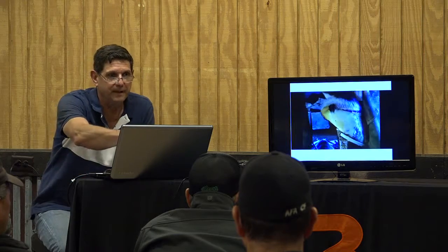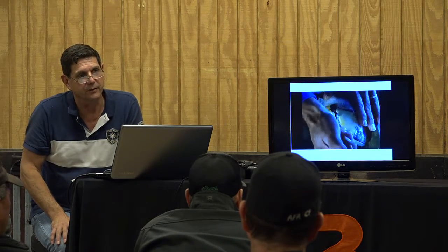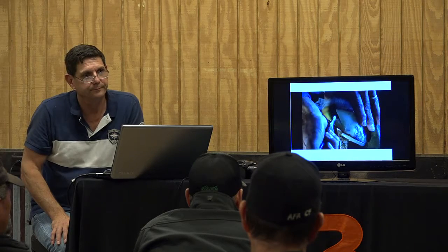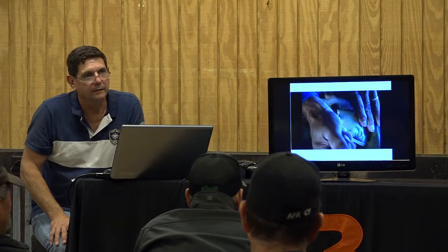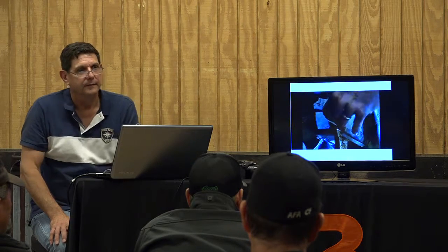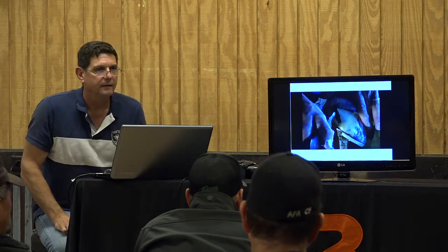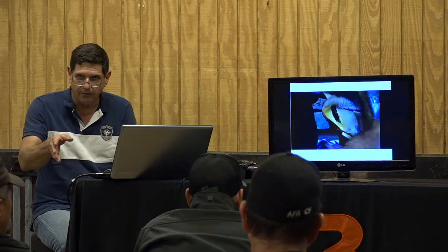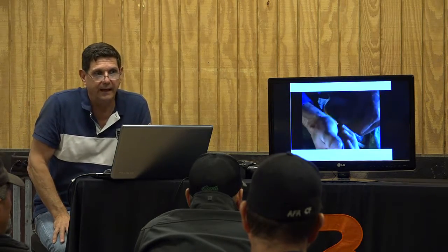Now I put in a piece of that butyl tape, which now I'm going to take out, which sits right over this crack. Sorry about the lighting. So basically, you're going to take out the butyl tape, and I'll be back down to the cracks exposed so they can treat it. I'm not looking to patch this thing today. I just want to stabilize it.